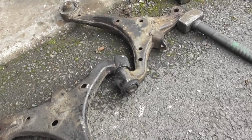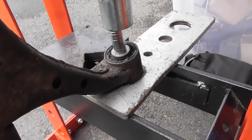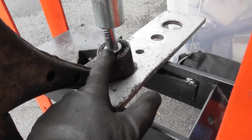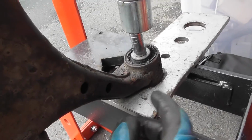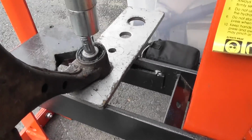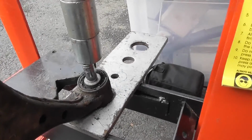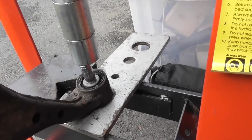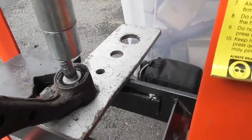So I'm going to use the 10-ton press again and see if I can just push the middle out. This is the setup. I've got a small socket in the middle, which actually fits in the middle of the metal part. And then this little ring piece of metal comes with the kit, comes with this strong arm kit at least. And then try and press that through. It's offering much less resistance now it's been set fire to, which is good news. It's actually starting to delaminate.